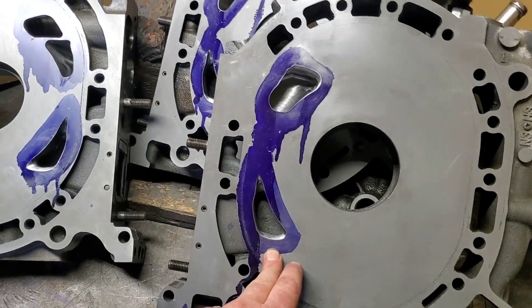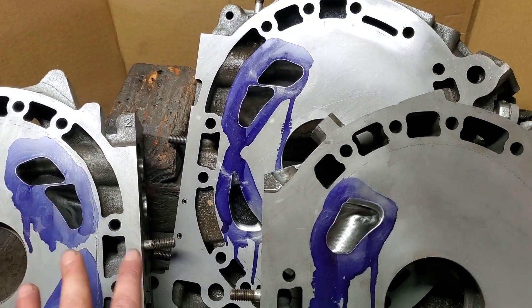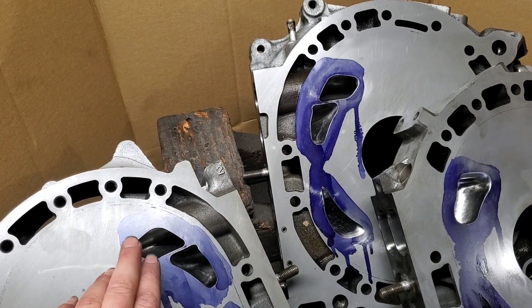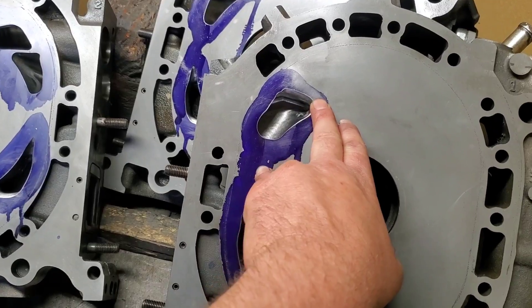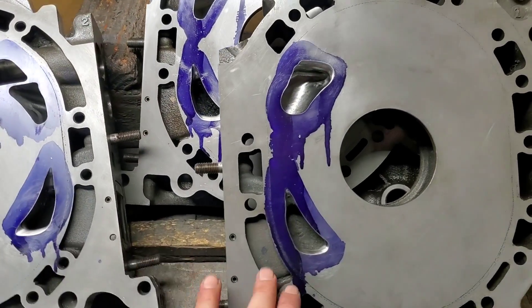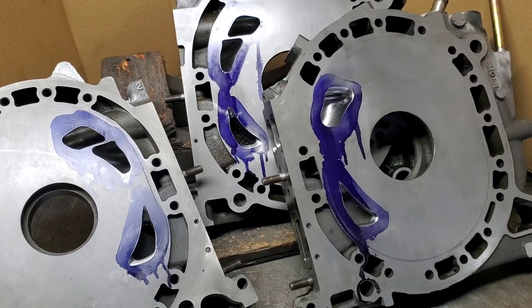That's what it's all about — getting exhaust heat out of the RX-8 motor. With the street ports, whether it's a KMR or Racing Beat, there are a few different options out there. They are increasing the duration of your 6-port opening, so you're getting more volume and more duration. Same thing on your primary port — more duration, more volume. And on your exhaust, you're getting a slightly earlier opening and slightly more flow available, which is only going to help the motor last longer, breathe better, and perform better.